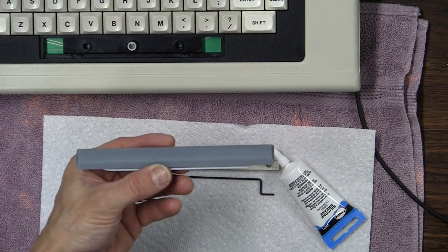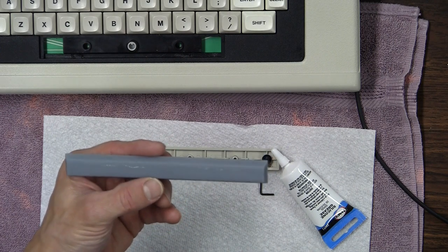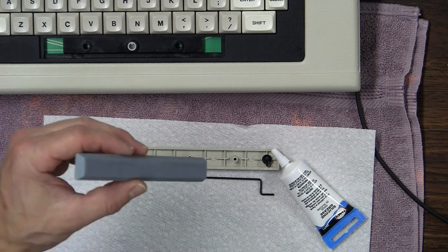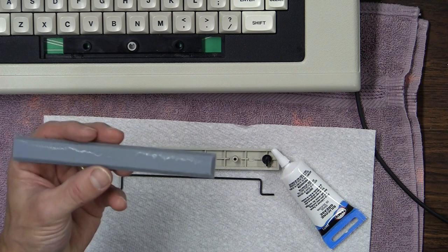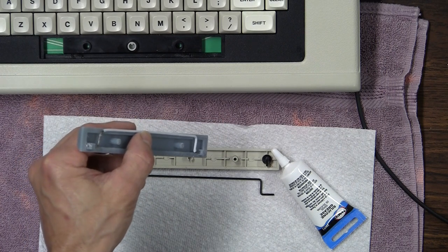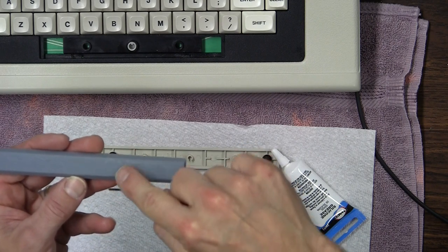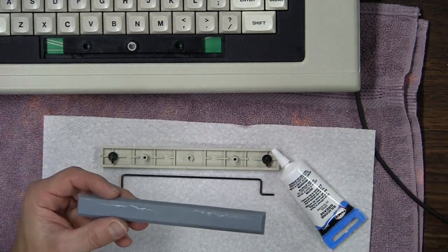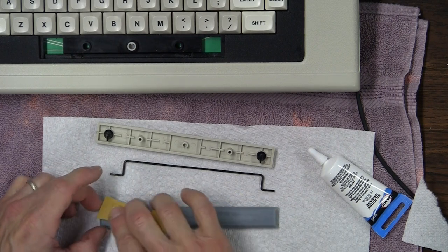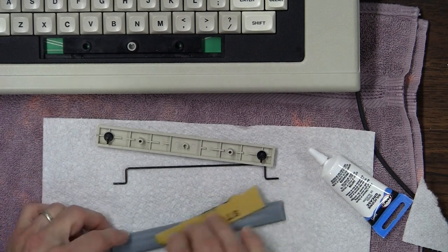It had plenty of grease under the tabs and it attracts dirt, but so be it. The replacement key is going to have some silicone grease on it — this is silicone grease I use on floppy drives when I refurbish them, just a plumber's silicone grease you can pick up at the hardware store. There's just a little bit of a sheen on top of the key. Because of the print orientation — I had to stand it up to print since my printer isn't long enough — it left some wavy layer lines, so I'm going to take some 2000 grit sandpaper and smooth the top side before it goes in.